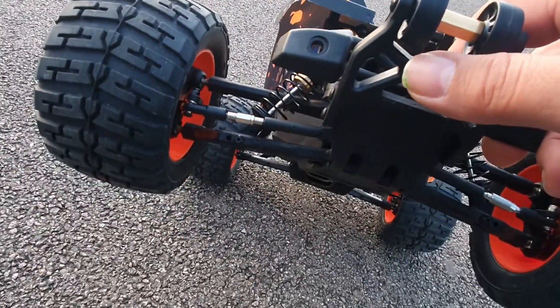You don't know what oil weight to use, so I've tried about seven or eight different weights. I've got to the point where I can do an oil change on all four shock absorbers in about 10 minutes. I now have CST 200 oil in this — that actually came with my drift car — and that's sorted it. I started at 3000 CST and worked my way down, and it's just been a pain. Because the suspension oil was so hard, it just broke everything.